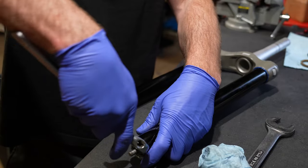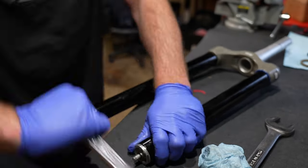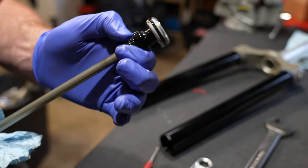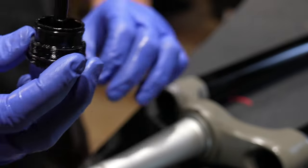The air spring is held in with some wrench flats. You can use a crescent wrench on this and the air spring is extremely easy to remove. It's a very standard looking air spring inside the Suntour Duralex — it does feature a pretty big negative air chamber, so remove the top cap because you want to clean this.